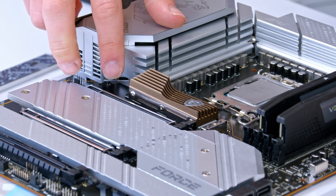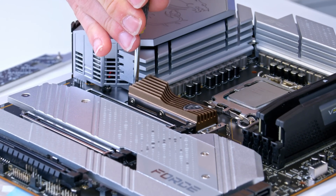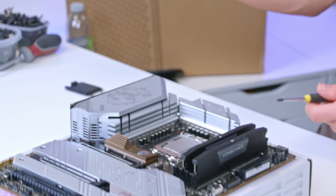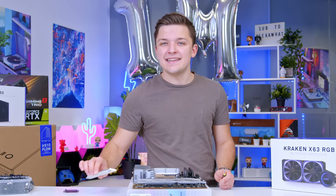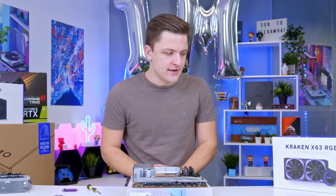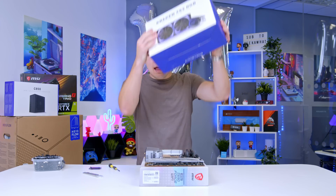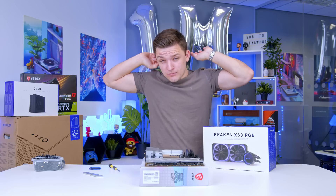The drive comes with its own heatsink built in, so we don't need to add back the heat spreader we removed. MSI's tool-less installation process means you don't need a tiny screwdriver, though it might be a little easier with one. Make sure you keep hold of the heatsink cover as you may need it if you swap your M.2 drive configuration later. Now we're not quite done with the motherboard — we need to prep the CPU cooler mounting hardware now, because if we don't, it becomes a lot harder once the case gets involved.